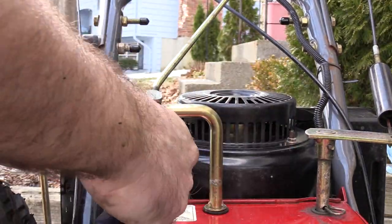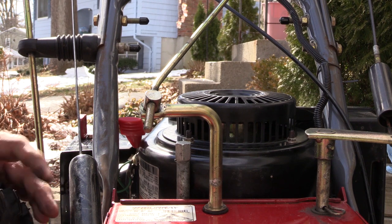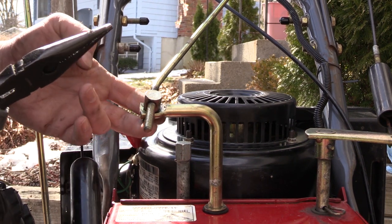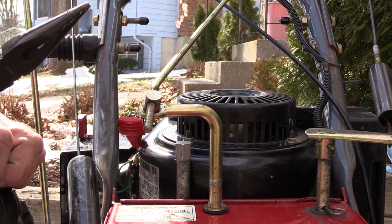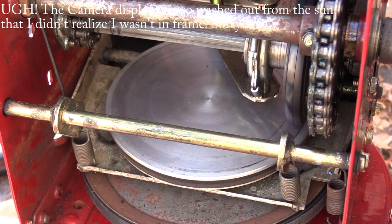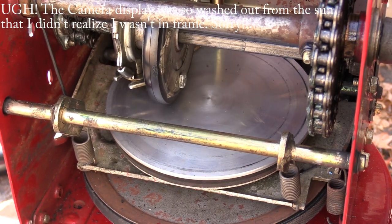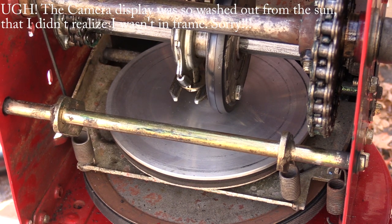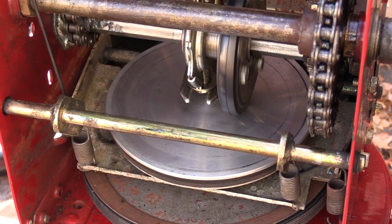Don't forget to put that cotter pin back in. I didn't lose it — that's a good sign. A lot of people only bend one side of the cotter pin, but I'm going to bend both. Now that I've bent that piece of metal back and forth, the likelihood it could break is higher — so even if one side breaks off, I still have the other. In sixth gear it's right at — probably further over than factory, but I'm okay with that. Reverse one is left of center, reverse two more so. First from reverse and sixth shows the right play in the mechanism — that's perfect.